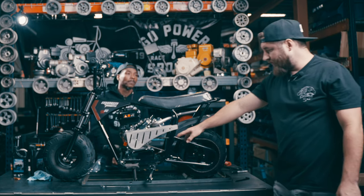Check your throttle to make sure all the movement on your throttle linkage is working all the way. Always check for wide open throttle and make sure it returns back pretty smooth. If you need a little bit more tension, you can adjust this guide keeper back and forth to give you some play.